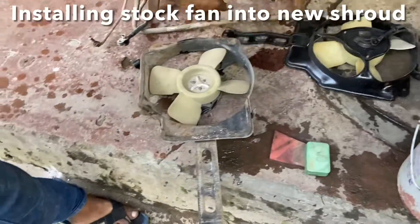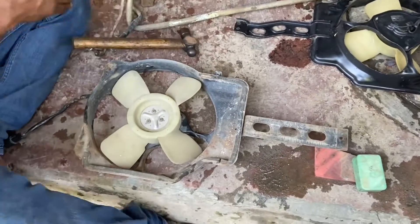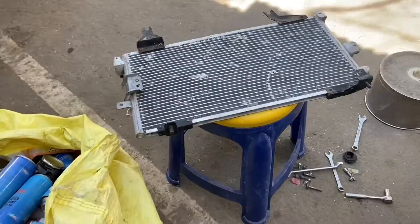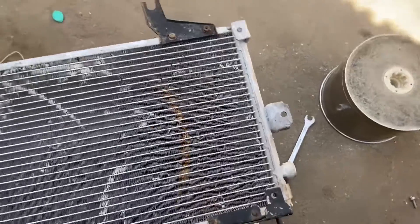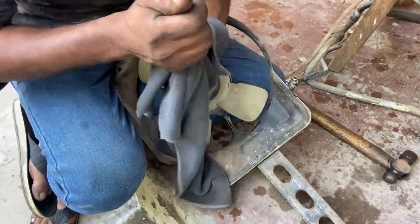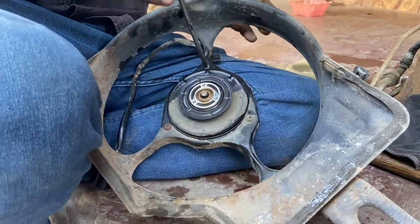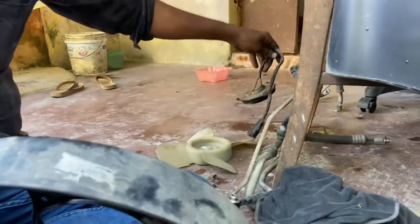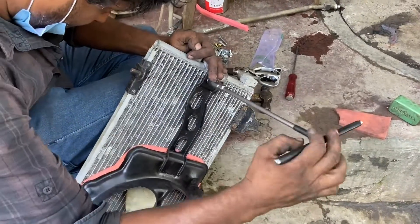What you see here is the stock fan assembly from the condenser unit. This one does not fit the R134A condenser unit as the mounting points are different, so we will take the motor and impeller assembly from the stock unit and fit it into the R134A shroud. Here you can see the replacement condenser and the mounting locations are different from the stock unit. We are now removing the impeller unit from the fan assembly. Three Phillips screws hold the impeller to the spindle, and once the impeller is removed you can see that three more Phillips screws hold the motor unit to the shroud.